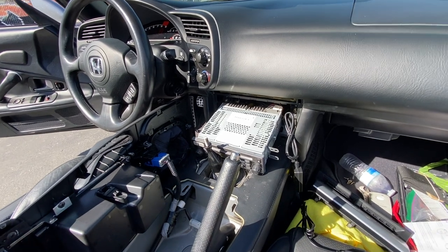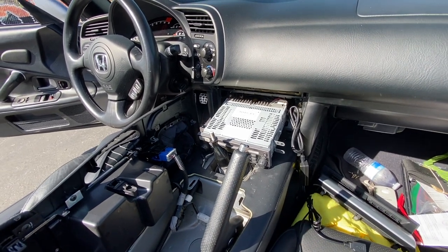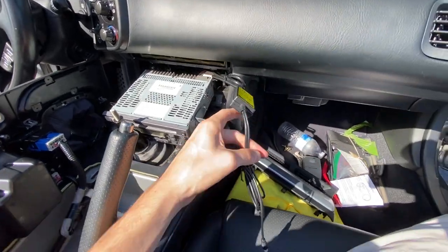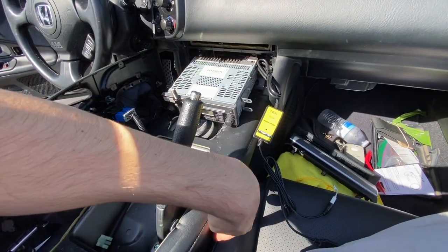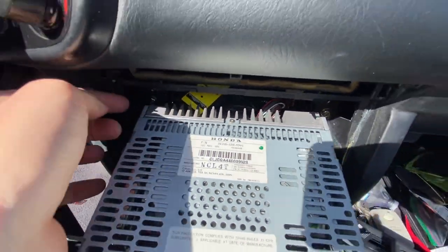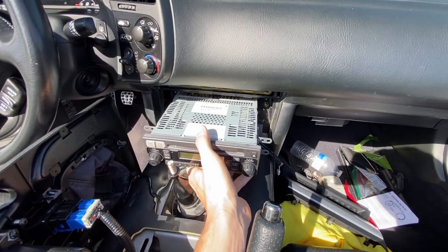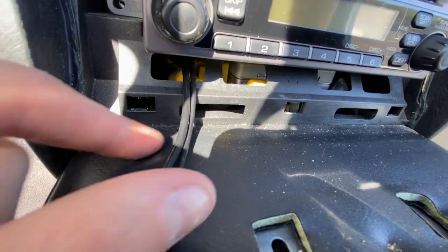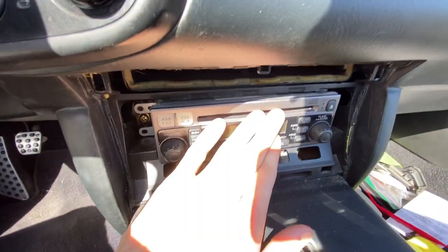I think that's a very necessary thing for any car. This is a super simple fix and it's about 40 bucks in total — makes a world of difference. I'm going to tuck this box behind here and run the wire so that it will come out right here. While there's not loads of room back there, I just stuck the little box there, and then it's going to be a bit of trial and error as you shimmy this back into place and make sure the box isn't blocking anything. I suggest you actually run the wires through this little hole, as it'll be sandwiched once you put back on the radio lid. I've managed to get this into a good spot — the box is behind, the plug is in, and the wires are run right here.